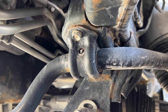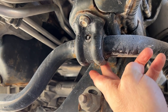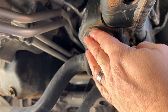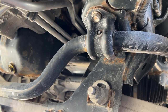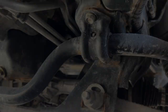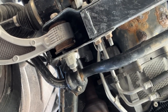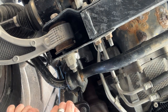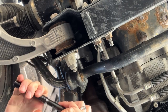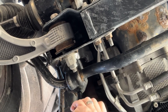First you're going to remove this 15mm bolt and there's another one behind. If you think yours are corroded in behind, you can access it and spray some penetrating lube to get into the threads. I'm going to angle the camera up so you guys can watch me remove it — not the best shot because I don't have fancy camera stuff. I did not put penetrating lube on this side. Let's see if these are as easy — a little bit stiffer, not too bad. That one's pretty loose.